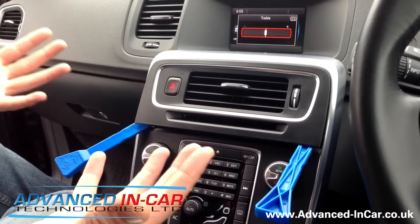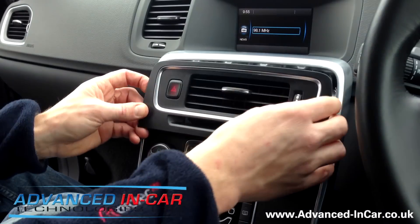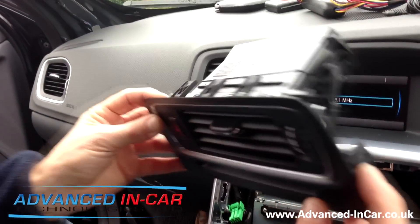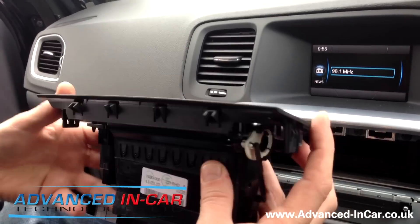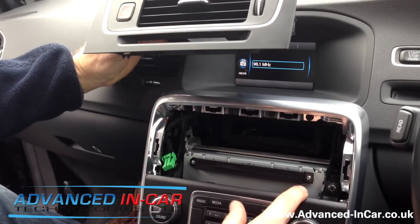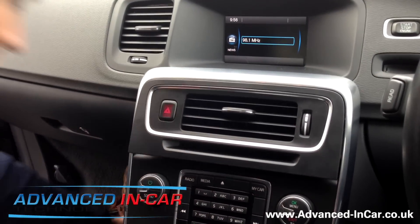Once you've got your two trim tools in, use your fingers. Actually, that was a lot easier than it should have been — maybe I'm being a little bit too strong there. These clips at the top — once I've unplugged this I'll show you, we've already had this bit of trim out this morning. So you've got the hazard switch — simply unplug. At the top you've got one, two, three; the sides you've got one and two. But the bottom — these little clips are the ones that are going to cause you a problem. Once you've got this bottom corner out a tiny bit, you need to get your trim tool in here to release the pressure on the bottom part of this plate. If you haven't released these four clips, you're not going to get any movement or leverage for that bottom part of the trim to come out.